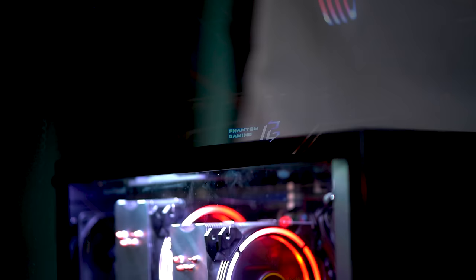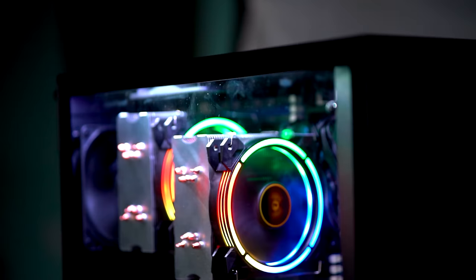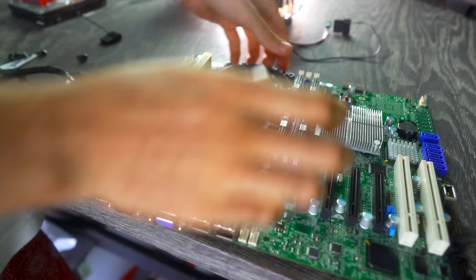And what I'll do quickly is, if you want to do something like this with a Supermicro X58 series motherboard, then the problems that we came into was those motherboard sockets initially. They had the screw holes coming out, and so we had to replace them, and we were lucky that we had two dead X58 motherboards lying around. We're able to use those sockets and then mount some pretty cool RGB bling worthy coolers on board. So that was the first problem we came into.